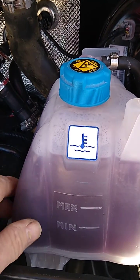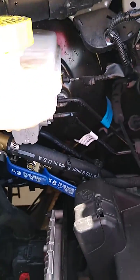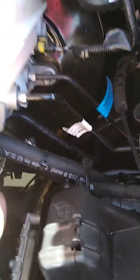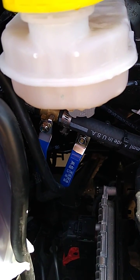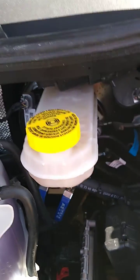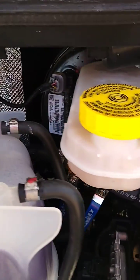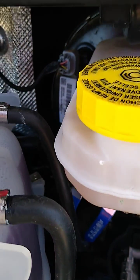Reservoir's up to level, actually slightly over full, but that's because it's totally hot now. Both of these valves right here can be cut off. What you do is just reach in here and turn these things sideways like that, and now there's no more hot water going to the hot water heater. It still has the anti-freeze in the lines, but this way I can shut the thing off when I don't have water in the water tank, and I don't want to run the heater during the winter or something like that. Or if I need to shut it off on the side of a trail somewhere — if we were to spring a leak anywhere, I could shut the lines off there and maintain the integrity of the cooling system.